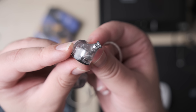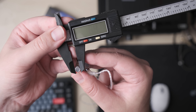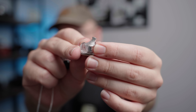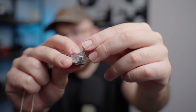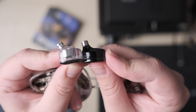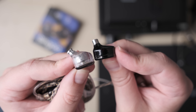There are a couple of factors in this. One of them is that the nozzle itself — it's a chonky nozzle. For those who are sensitive to chonky nozzles, this might also be an issue. At the widest point, I measured this to be around 6.4 millimeters for the nozzle, so it is a little bit on the larger side. But what I find is the bigger issue — and I can actually feel this as I'm pushing it into my ears more thoroughly — is this contour, the side, basically where the nozzle attaches to the shell, is a bit on the bulbous side. And this is what causes it, in my ear at least, to sit a little further out of the canal entrance, rather than sitting a little bit more flush compared to certain other IEMs that have a nozzle that sits a little bit further away from the rest of the shell.